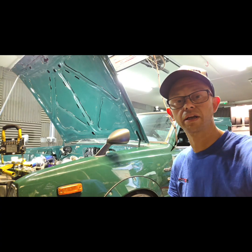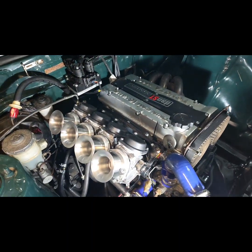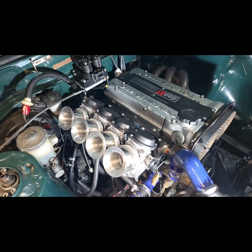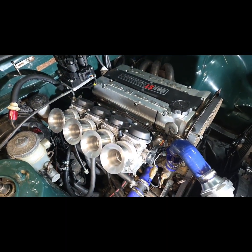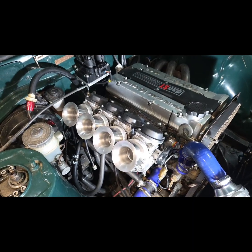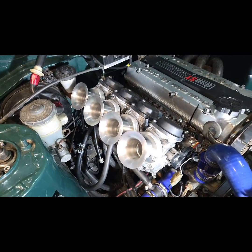I'm going to show you around first so you can get an idea of what we offer in our kits. So hopefully you can see what we've got going on in this engine bay. We've got a set of our 37mm ZX6 carburettors — ideal size for an engine like this. They'll easily do 175 brake horsepower, and we've actually seen them on bigger engines doing more like 190. So plenty big enough, really drivable, really nice set of carbs. The slightly later Mikuni ZX6s fitted here have also been fitted with our optional spun aluminium trumpet upgrade kit. The customer has purchased the air filter and backplate as well, but at the moment he wants to run the open trumpets to make it a bit more showy. So we've fitted our 37mm carbs — it's a large port engine, an earlier one.